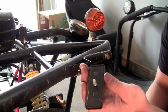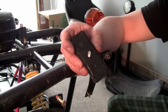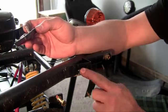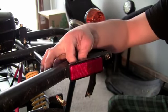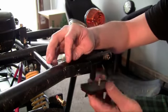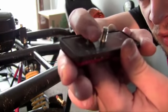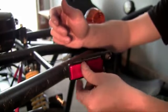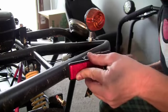Installing reflectors is really easy — you pretty much just mount it on the back. There are just a couple things to remember. First, if you noticed, there's only one bolt coming out of this reflector but there are two holes. The reason for that is you don't want it to spin whenever you're riding around hitting bumps. They put a little nub on the reflector — your bolt goes into one hole and the nub goes into another, and when both are lined up, there's no way the reflector can spin or move around.